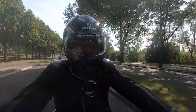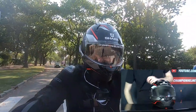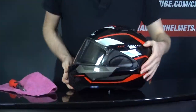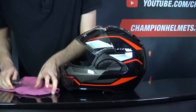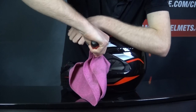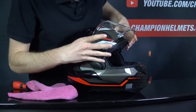The visors of the E-S and the Evo 1 II are the same VZ150 visor, so you have the same visor replacement process. You'll need to bring a screwdriver or other small object, then make sure the visor is in the open position. Make sure to cover the screwdriver to avoid scratching your helmet, then push in on the two triangular notches on either side of the visor. Once pressed in, you can slide the visor out of the mount by pulling lightly up, and to put the visor back in, you simply snap it back in again in the open position.